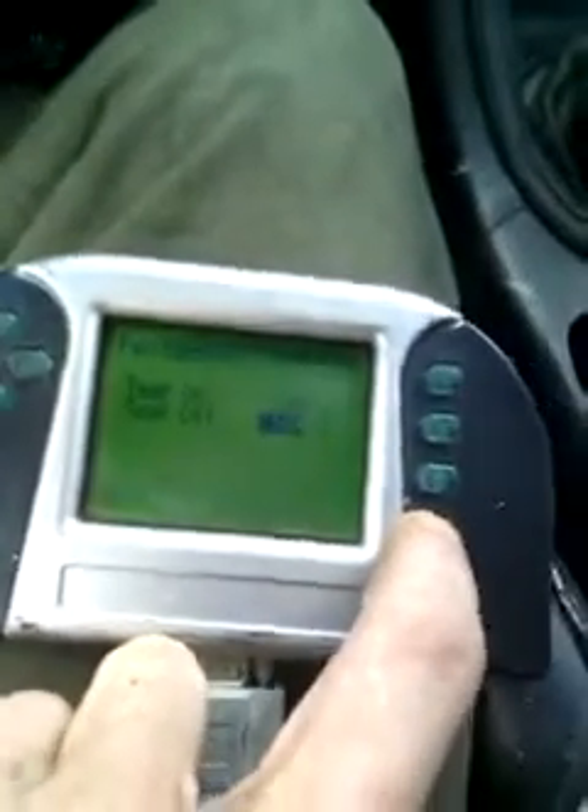Quick little video here — anyone running a PMS, go into your fan control. If you've got a Cobra 96, they like to run hot. With the recall, you're supposed to put in a 98-style radiator, and a lot of that recall has been done. My car was just at operating temp, and I'm going to set it so my fans come on at a cooler temp. You can hear it running high, then kick down low, then off — as you can see, 180 degrees off.